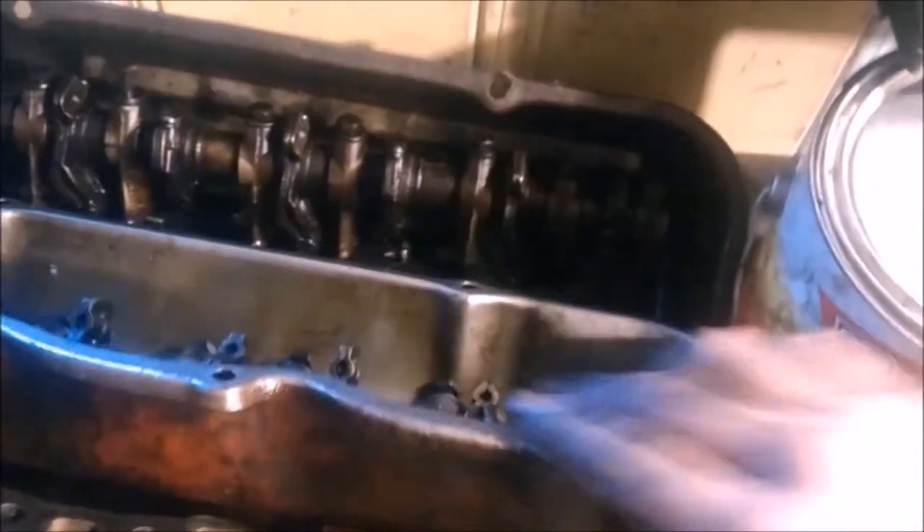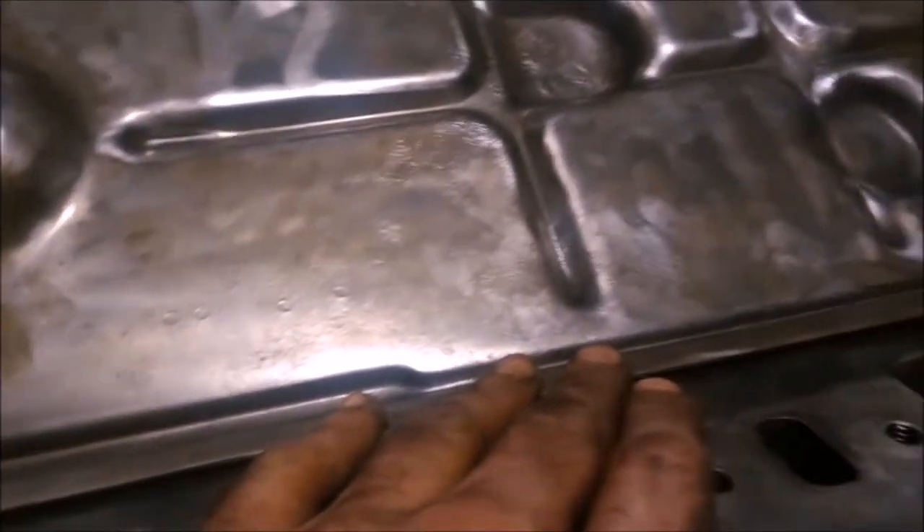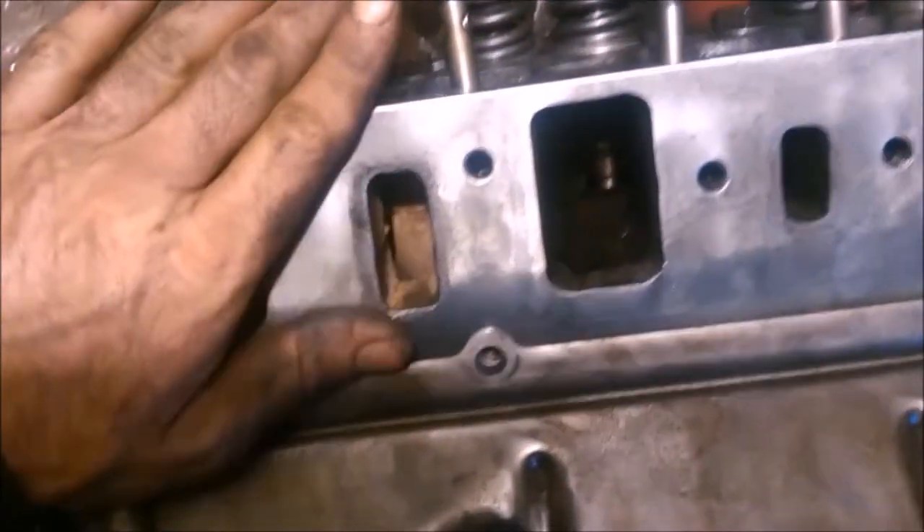Outside surface on the wire wheel, inside lightly brushed by hand, then washed up. Same for the valve covers — make sure they're straight. You can tell by just setting the pan down dry to get an idea. Also want to change this grommet if you have one — you've got to get it straight or it's never going to seal. Don't go gooping gasket maker on there. When it's centered you'll notice it doesn't quite line up with the holes because you don't have the gasket on — that little bit of gasket difference is going to raise it and make the difference.